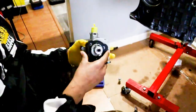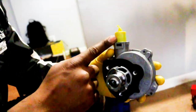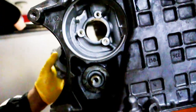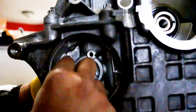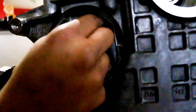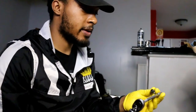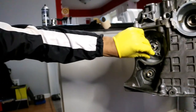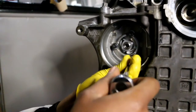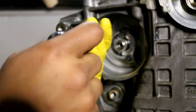That's how your gasket should sit. There are three new bolts. This goes from the back of the motor — you want to make sure this portion is facing up, but right now I have the engine upside down so it's actually going to be facing down, and the bolt pattern should match up with it facing down. I'm using a T30 and the torque spec is 11 newton meters. I'll run them all snug first and then torque them down.